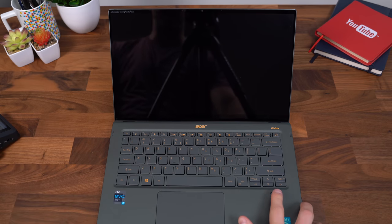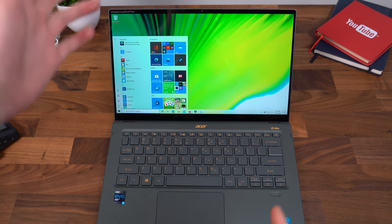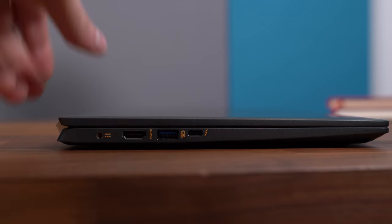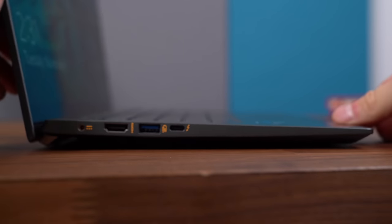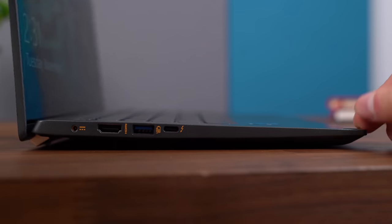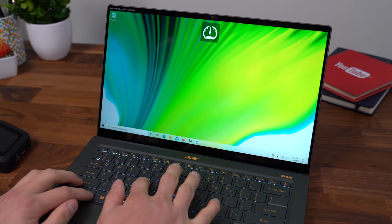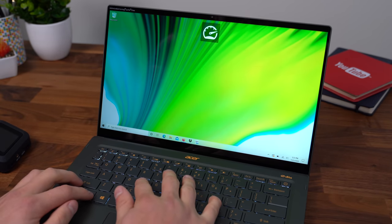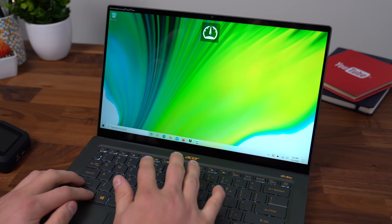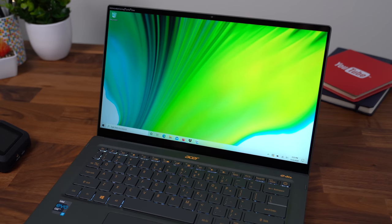Let's put it back to sleep. With it asleep, I want to set my finger on the fingerprint scanner — and that does actually wake it up and unlock it right away. You saw how fast that actually was, kind of crazy. Something pretty cool: when you open up the laptop, the hinge will actually raise the keyboard off of the surface it is on, which will help with heat dissipation and give it a little bit better airflow. There are also multiple cooling modes — a quick shortcut with the function F key will go from silent, normal, and performance.